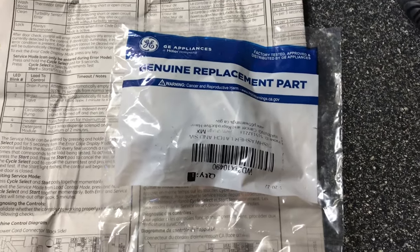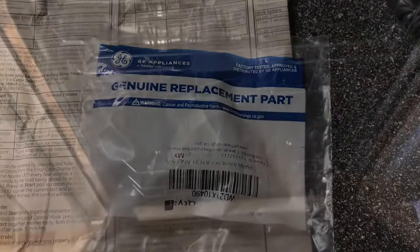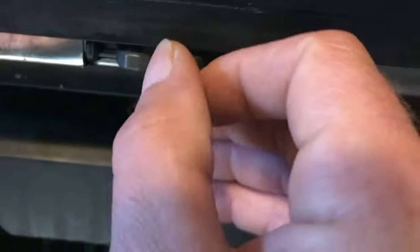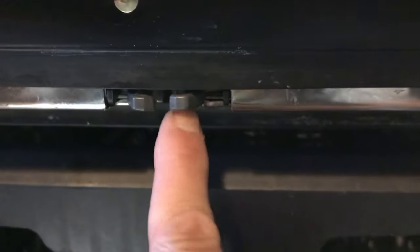With the door switch diagnosis confirmed, go to Amazon — I'll include a link to buy your GE genuine replacement parts. Look up your model number; I'll show you where to find it. Open your dishwasher and the model number tag is right on the side. Now let me show you how the door switch works: this little probe here — when the door closes it sets the contacts, and when it opens it breaks that contact, letting the control know the door is closed so it can start the wash cycle. Contacts fail from wear and tear.